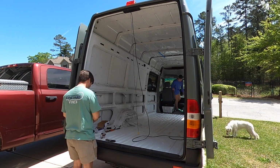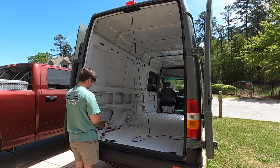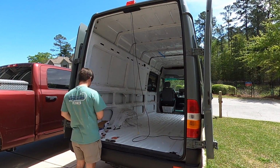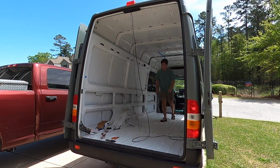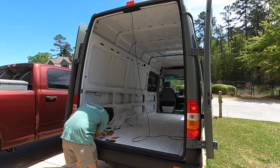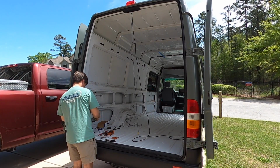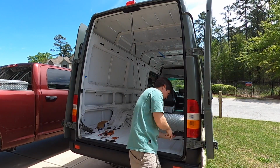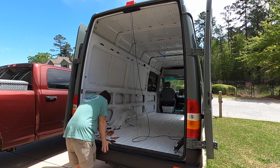It's a real simple design, and all I did was have Lauren crank the van up, figure out which lights come on for reverse and which lights are on all the time. On T1N Sprinters, as you can see here, when you crank up the van, the lights automatically come on. They're not controllable. It's when the engine's running, the lights are on. So I use that constant 12-volt power to supply voltage to the camera.